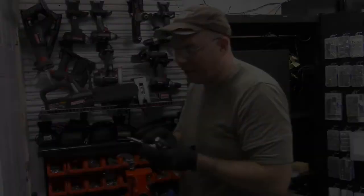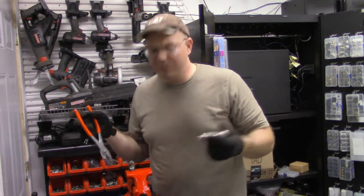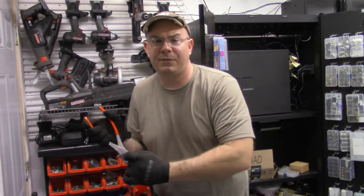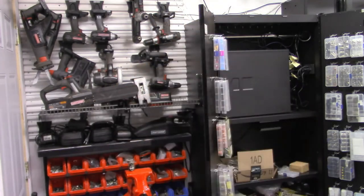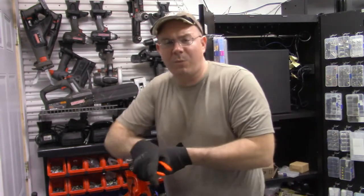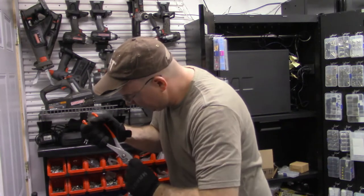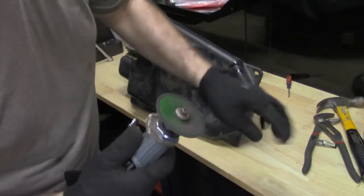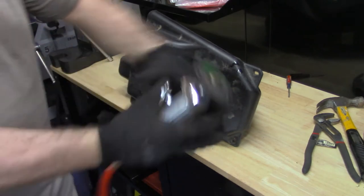It's a way that they cut cost and increase. I mean, to go to the Polaris dealer, you're talking, I now have to find a whole nother gas tank for an ATV that was rare, basically with the 525 engine, and find one that matches this, or buy a new gas tank from them, which is going to be $300-$400. It's just nuts. Do not do this without the gas tank empty and vented out. This gas tank will explode.